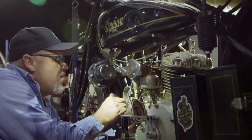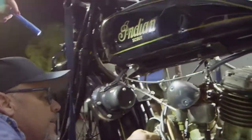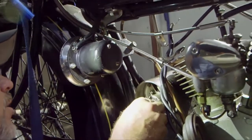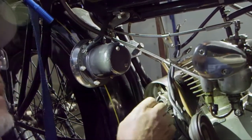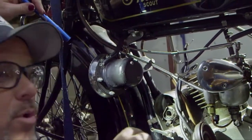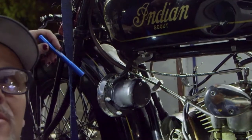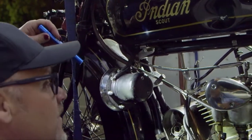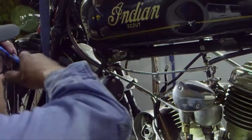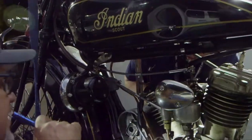I'm going to turn it over to Deedee later — come around this side, Deedee, so I can see. In the good old days you would obviously use a timing light, but we don't have a timing light, so we're using a wee little piece of shim. I like to use cigarette wrapper — it's perfect. Jim, are you ready? Put them gears in for me. My lovely assistant is going to put the gears in.